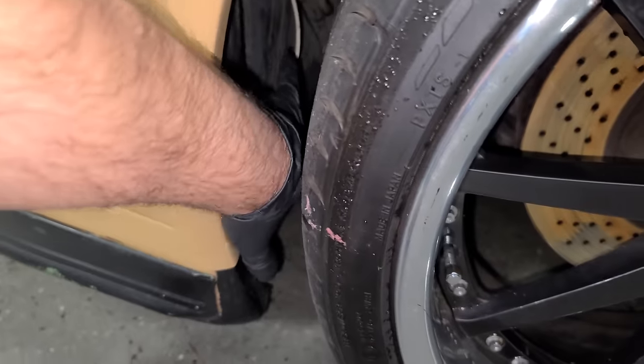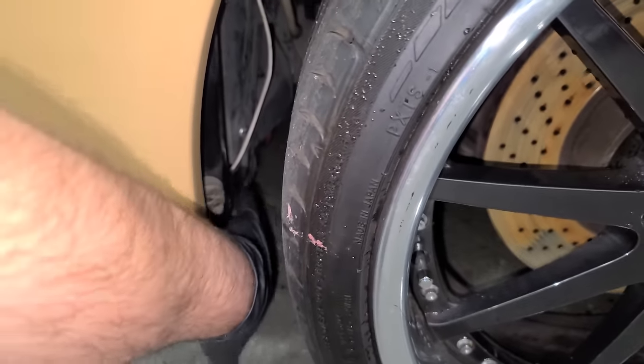Yeah, we got nothing. This driver's side factory fan is not working at all. And it didn't increase the speed of this one either. This is more awesome fan goodness. I mean, broken fan goodness. This is what we want. That is a smoking gun. If we only have 50% of the engine cooling fans working and restrictive pushers right in front, that could be it, guys. We might be able to fix this thing for free.